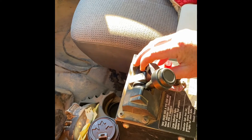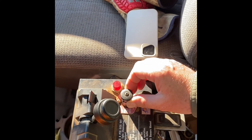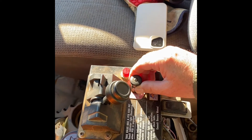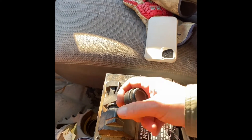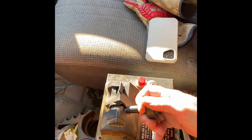Now the PTO is engaged — open up your tailgate. Some trucks have the latch here, some have the lock on the side of the box. On the newer model they have the tailgate latch here — pull up this lever and lift it. That starts putting hydraulic oil into the box, and you can see the box going up behind us.